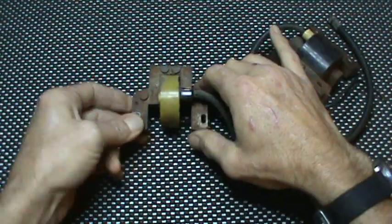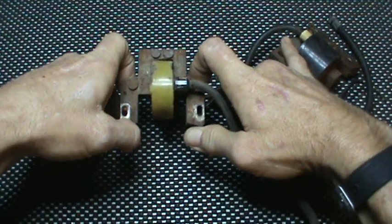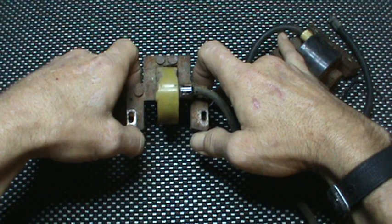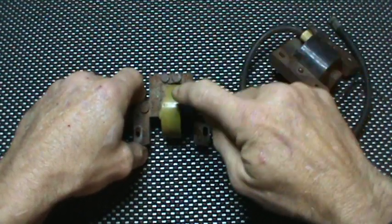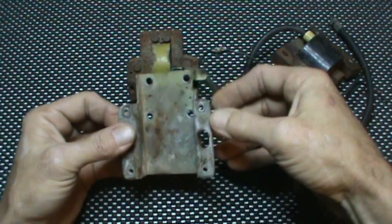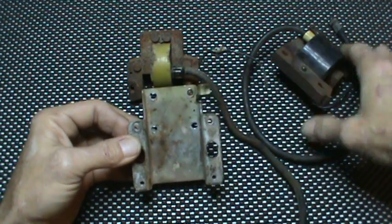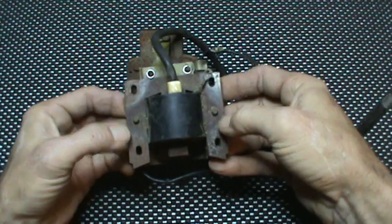The difference in the height and spacing matters because it's got to meet up with that flywheel just right. With the earlier 23Ds, the taper on the cone that the flywheel mounted to was pretty steep, and its location was totally different using the 23D coil than it was with the later models — even just one year later when they went to the 10-horse engines. What you had for a mounting plate for the 23D was a real shallow, just stamped steel piece that mounted to the block using bolts. Then your coil mounted to that with four screws.